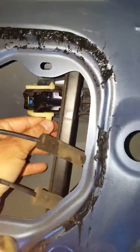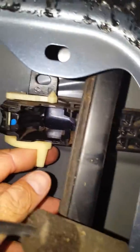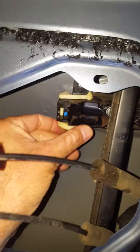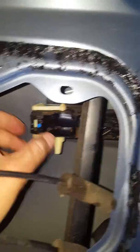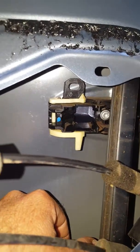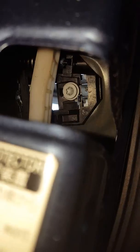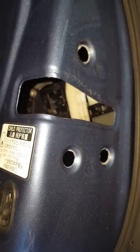So the door handle's in. Basically, I pushed it in and then pushed so the door handle was flush up against the outer door, right there. And then what I've done is I actually closed this in on the lug of the door handle, which then basically sat it in place. So now the next job is to just put the cover on, do up that T30, and then reassemble the door latch.